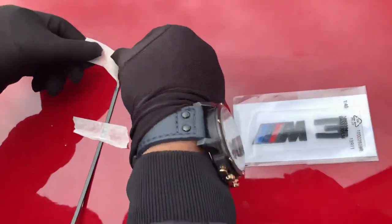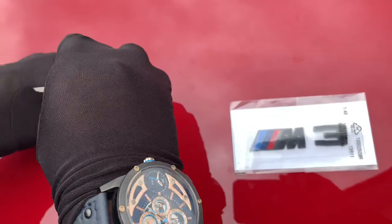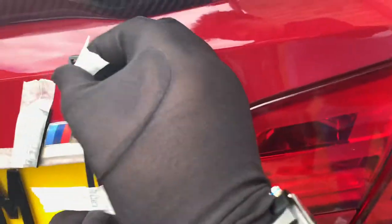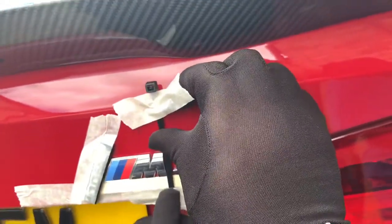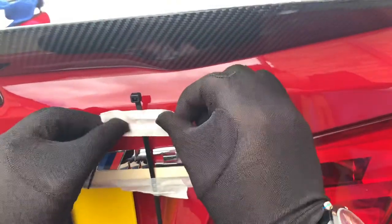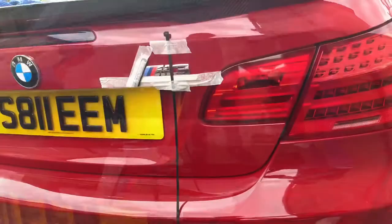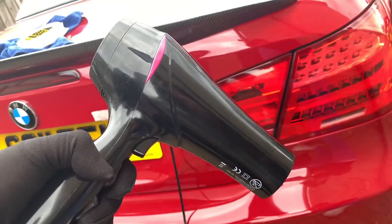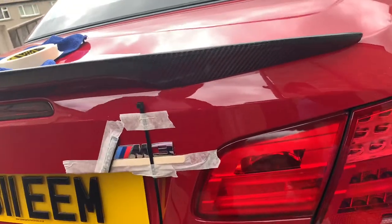Like performance cars — keep it simple. You'll stick it in between the gap, make sure we've got the measurements right — it fits perfectly for the gap actually. So we'll put that on there. What we're going to use is this heat gun right here to soften the glue, make sure the badge comes off nice and steady. There we go.